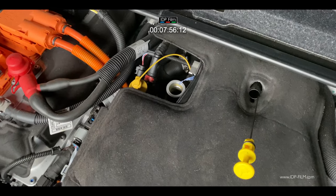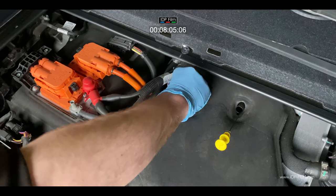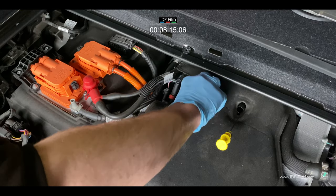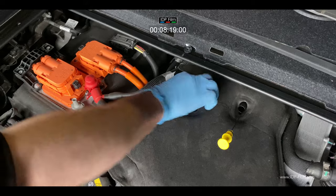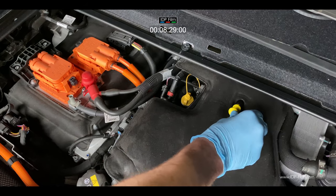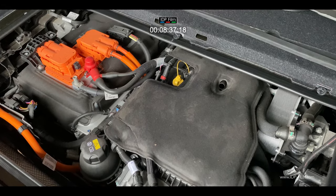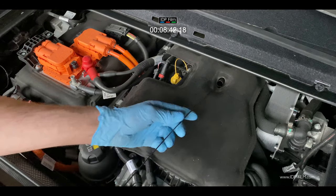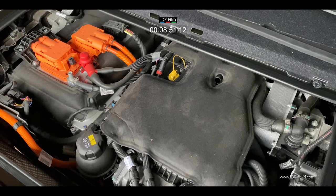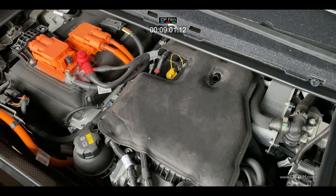No spill of any oil anywhere. Obviously don't forget to put the oil cap on top of the engine — that's the yellow plug; it screws in manually, just nip it tight. There is a rubber seal on the bottom, so just make sure that is nice and secure. The dipstick, as you can see, is on the left-hand side. We're going to check a reading now with the oil just filled — the oil hasn't settled to the sump yet. We've put 2,700 millilitres in. It will probably be at the lowest position or middle on the dipstick — actually it's showing the middle at the moment, so that's perfect. After we've given it an initial run, we'll check the oil level again.